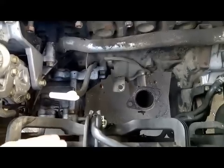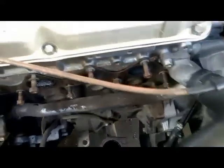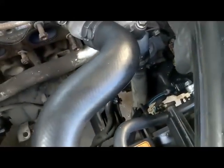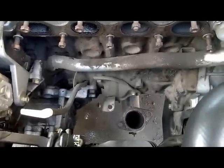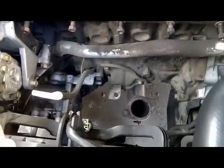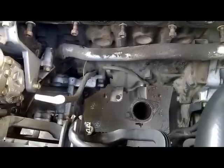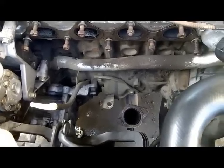The customer said the fan would keep running as long as there was power to the fans. He also noticed a couple days ago that one of the fans stopped working — the one on the right side. The left side fan still works. He also noticed that when the right fan stopped working, his cooling gauge would go a little bit above the normal temp range. So the next step is to check the operation of these cooling fans.